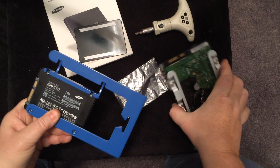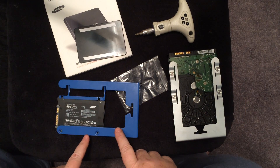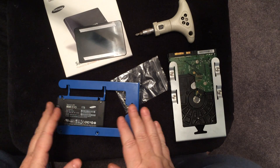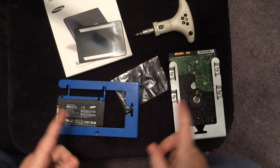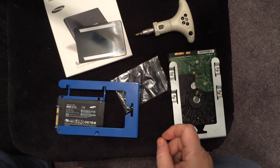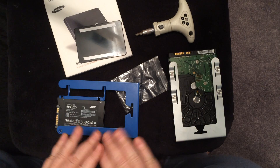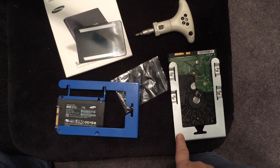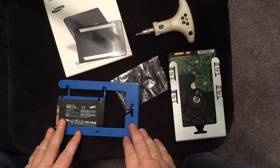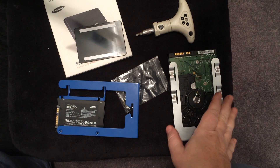Once you plug this in and restart your computer, you now have the opportunity to put either an OS on here or just use it as a second drive. I'd recommend putting an OS on it and then switching the boot. If you have two hard drives in your computer and you go to your control panels, you'll see a control panel called Startup Disk, and you can switch to whichever startup disk you want. It does not matter which slot you're in — you simply select the drive and it will boot off of it, while the original drive can remain in slot 1.